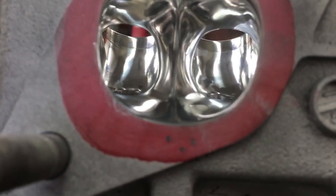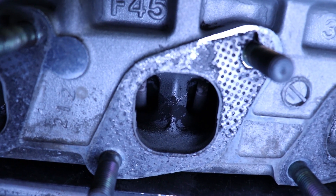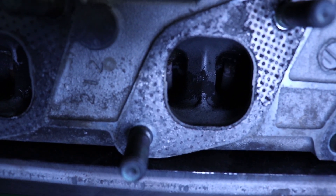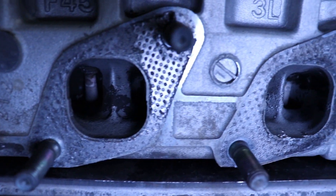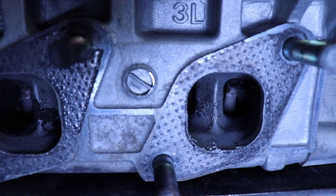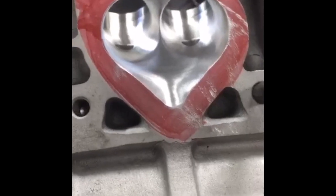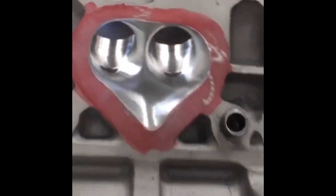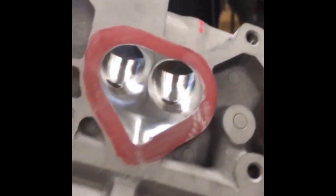Because the valves are full millimeter oversized, we cut the old valve seats out and put in oversized valve seats. The head casting is fully ported and polished — the exhaust side is mirror polished because I wanted to get as much flow out of this thing as possible, with the least amount of surface area on the exhaust port. The exhaust ports themselves have actually been redesigned because if you look at a stock KA exhaust port, it's very restrictive. Nissan could have done a way better job, but it's a truck motor. The intakes are really not redesigned — they've just been widened and port matched.